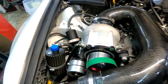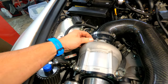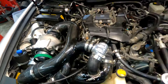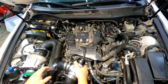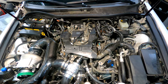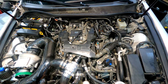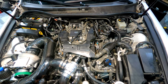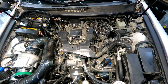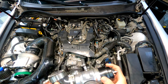Here is the reservoir — it's all self-contained, the supercharger oil. The other issue with these pipes: it would have been really nice if the pipes had a lip on them, because then you could use worm gear clamps everywhere and wouldn't have to use t-bolt clamps torqued just shy of crushing the pipe. If there was some kind of lip to hold the silicone tube, that would be better. I don't know how hard it is to add a lip on a carbon pipe like this.